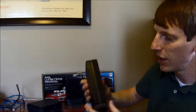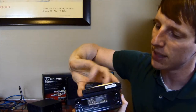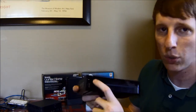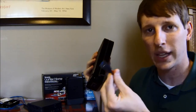The next style of external hard drive uses a different sort of power. This is the same hard drive that was in a desktop — the size is identical, it just has an enclosure to keep it safe for use outside the computer. This hard drive also has an adapter, and underneath you can see the same power and data connections from a regular desktop hard drive. We use an adapter that gives us an external power port and an external USB port. This has a proprietary connection, similar to a mini USB but with a small extension, and that serves as the data cable to plug into a USB port on the computer.